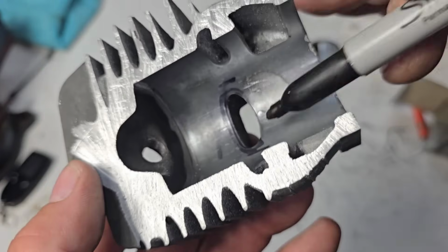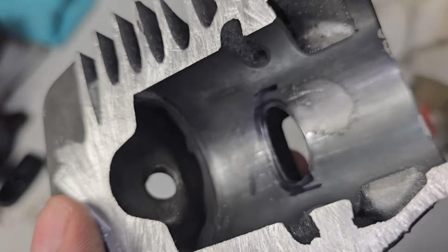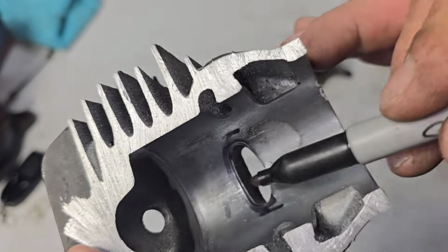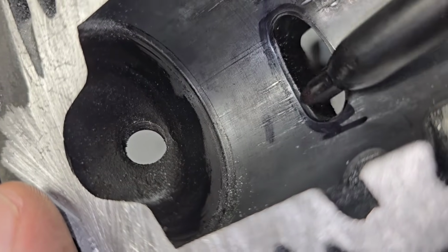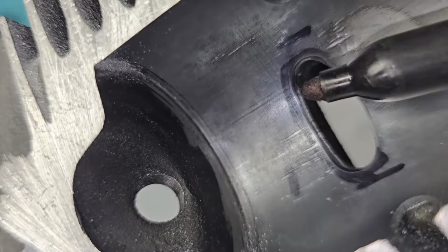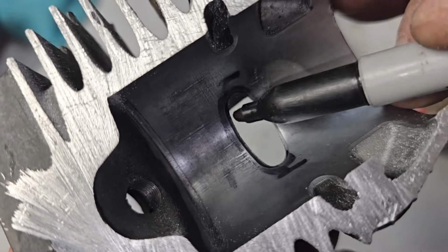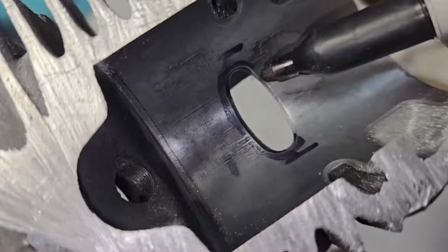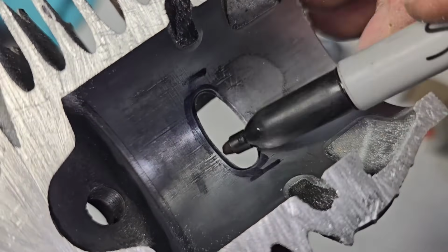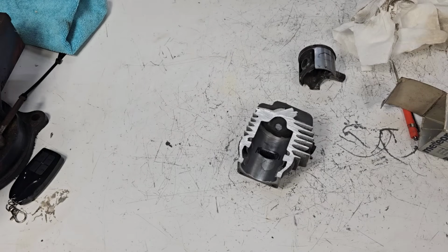Then when you're done, you're going to go in with a rounded diamond burr, those little round ones. I go in and I hit it and I grind this little bevel back in. Now remember, if you're almost at the top of the chip, a hair, use that final little bit as your bevel, and that's where you grind your chamfer in, and that helps the ring get in and out of the exhaust port. Okay, Doug? So, yes, you can grind a chip away.